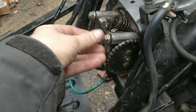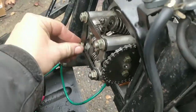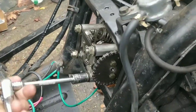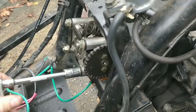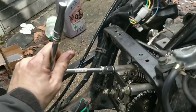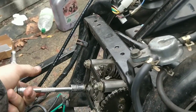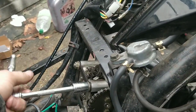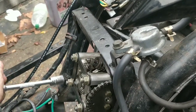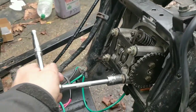See, look, that's four finger tight, and if you add the pinky, you get five finger tight, which is not what we're doing, guys. Okay. Oh, loosening. It's a 12. See, use the same pressure, same stance on each hand. Feel the same torque. That's it. And then go back round. Feel the same torque. There's a quarter, quarter, quarter.